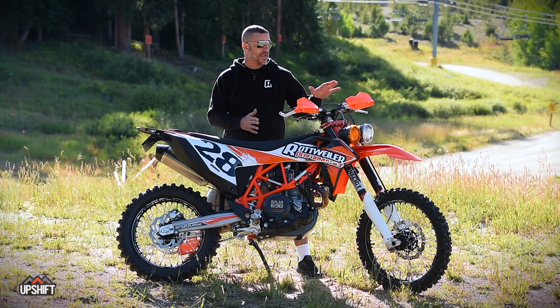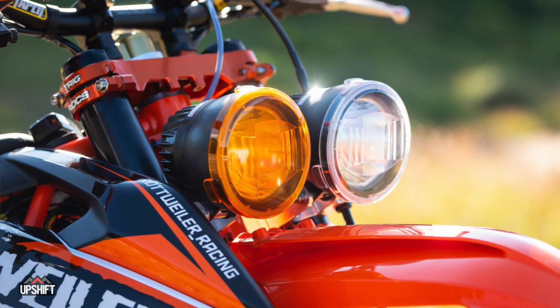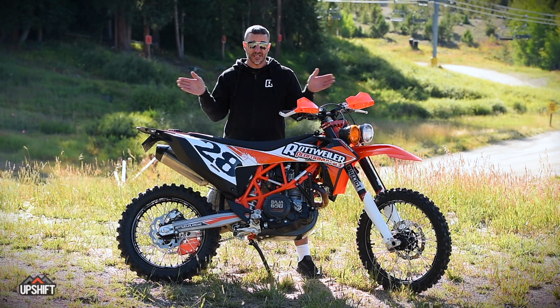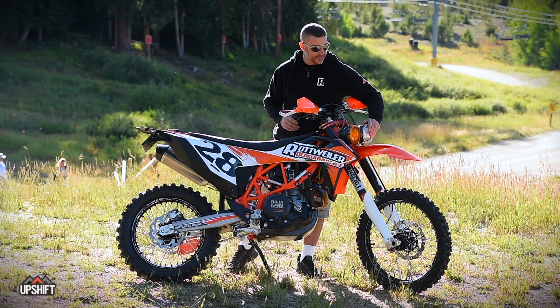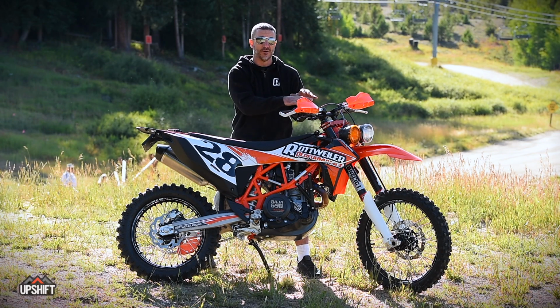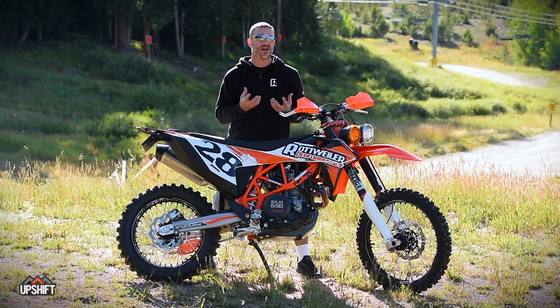But we ended up choosing a pair of Cyclops LED 40 watts in a dual fashion, and we have the diffusers in the front that we can actually use to change how the light pattern is spread. So we can pop off one of these diffusers here and have a pencil beam that reaches way out there for speed, and then we can put on kind of a yellow amber light for the spread, which is a little friendlier on the eye. So racing in Baja, the lights are really tricky. So we chose these lights.